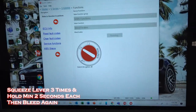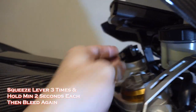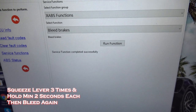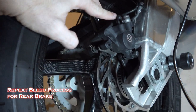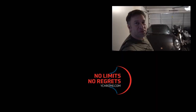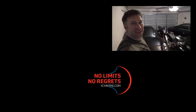And it says switch the ignition off, switch it back on, and it says service function completed successfully. I'm going to go ahead and bleed the brakes one last time and then everything will be good. Now you're going to do the same thing with your rear brake, though not used near as often. And there's the bleeder valve for this guy. Subscribe to my YouTube channel if you want to learn more about how to enjoy amazing machines like this.